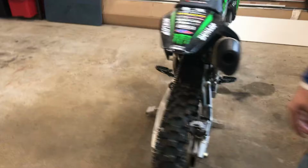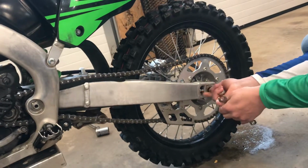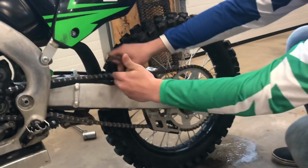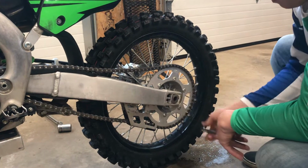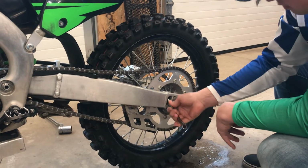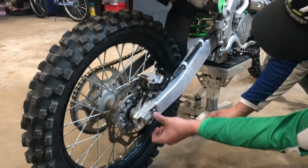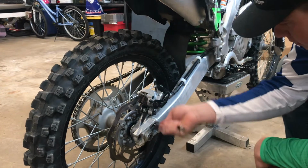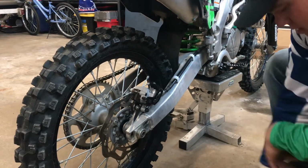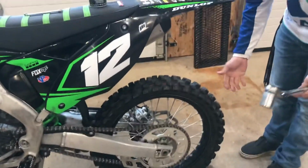We'll go back to the first side, and then taking our 12 millimeter wrench, we will tighten up our jam nut, which I can still fit 3 fingers under here, which is perfect. That's tight. Come around to the other side. Tighten up my fingers quick. Tight.